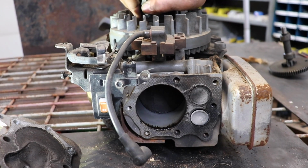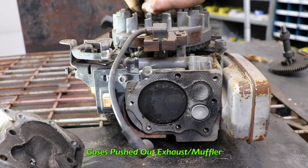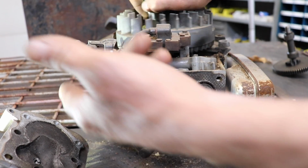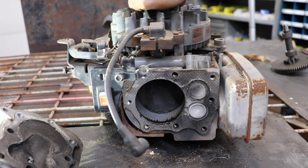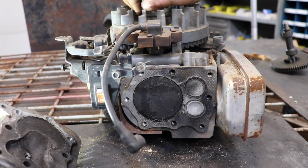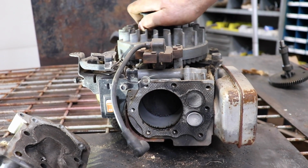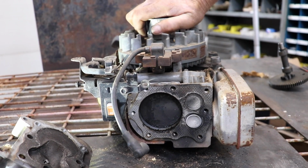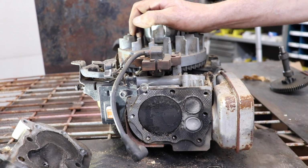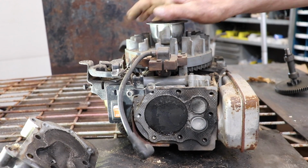Exhaust opens, piston's coming up, taking all those gases, pushing them out the muffler. And then again, down again, pulling in the mixture, closing the valves, compression, ignition, igniting it. The explosion pushes the piston back down, opens the exhaust valve, and pushes the stinky exhaust gases out. Those are the 4 strokes of a 4-stroke engine, as illustrated by our 4 strokes.